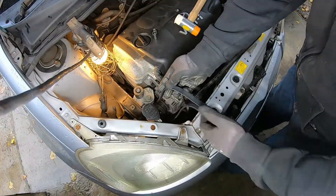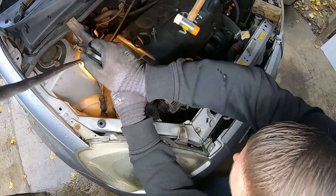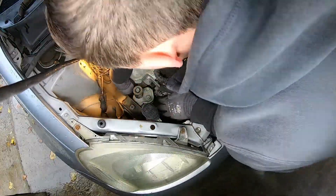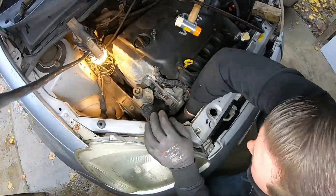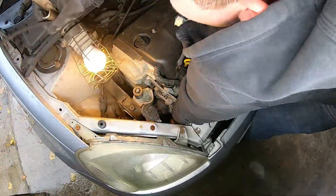I'll get the belt down there — it's a bit tight getting the new one on, so I'll prize it back a bit for now. That should give me plenty of space to get the belt on without missing out the ribs. Then it goes down and around the water pump, and then I can get down the bottom and on to the AC compressor. Lost the socket down there — fairly standard.